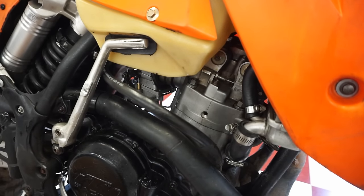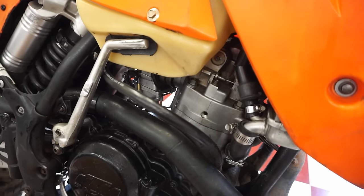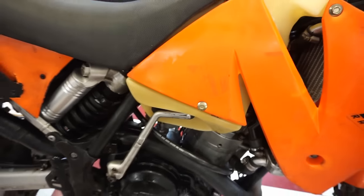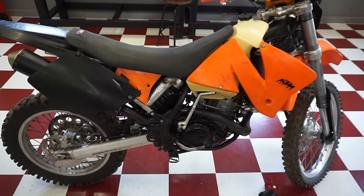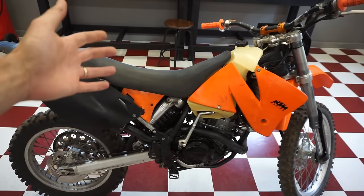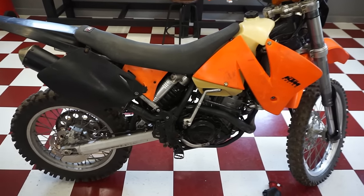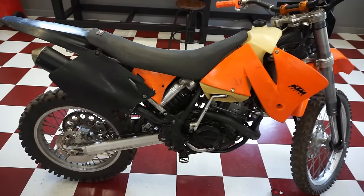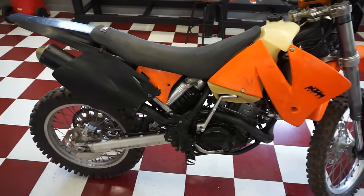So, I think it's getting too much fuel somewhere, causing it to bog down. I think it's gotta be that accelerator pump pushing too much fuel through, is my guess. But if anyone knows or has any idea what the problem would be, leave a comment down below. I'm kind of stumped on it because it's got the stock jetting in it. So, I don't know. It's very, very odd.